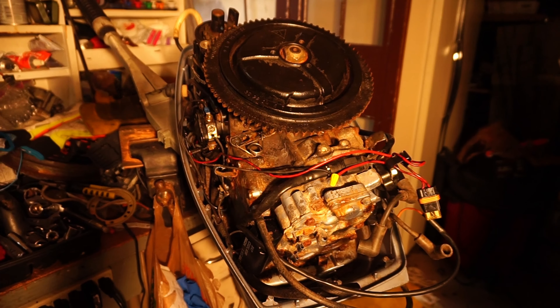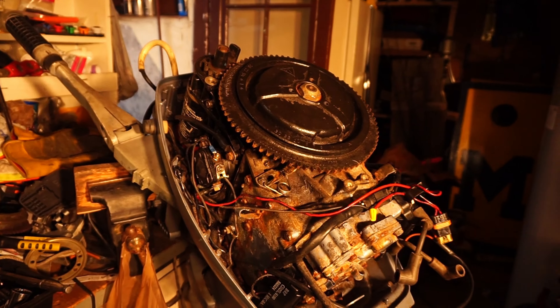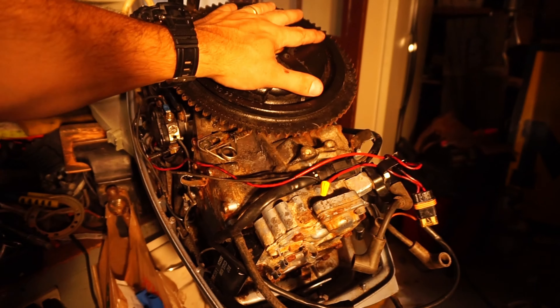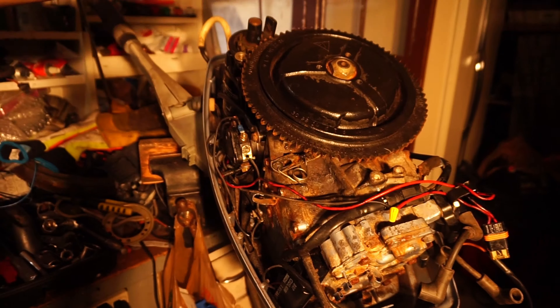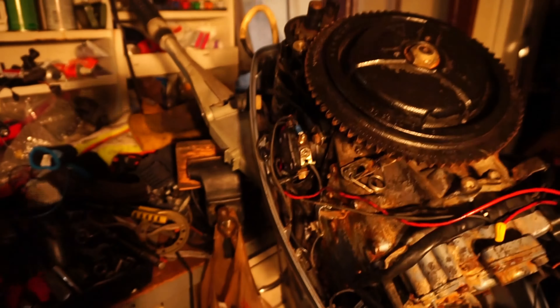The problem is, if it's a power pack, I'd have to order a new one, which would have been okay. But I had the parts motor, the 28. Y'all just saw me swap the new charge coil system. I did that so that the charge coil system from the old motor would match the power pack so I can input it all as one system.